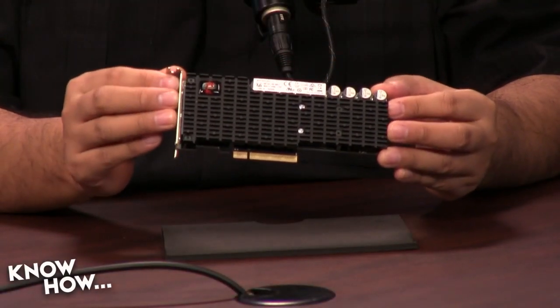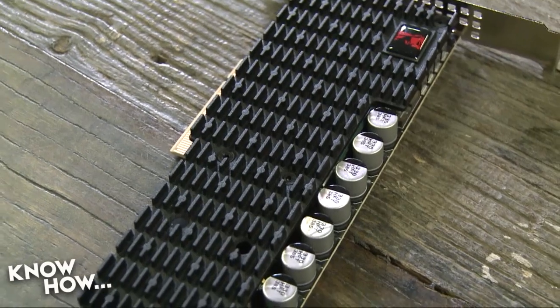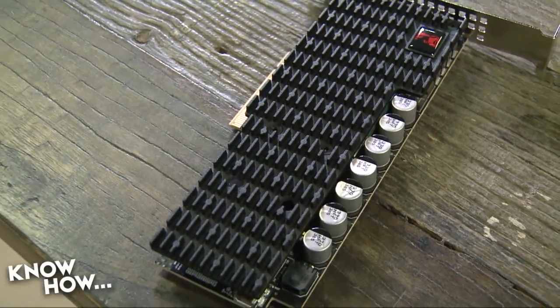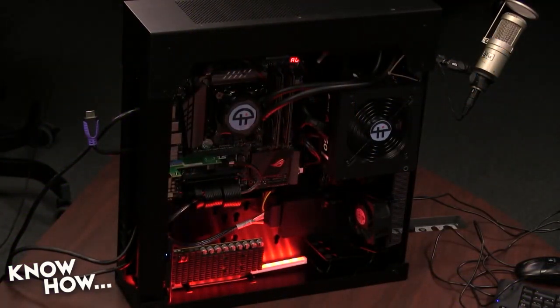What am I holding? So you are holding our new DCP-1000 NVMe high-performance server-class SSD. NVMe is really what's enabling the next jump in performance for solid-state drives. NVMe brings standardization to how we attach SSDs to the PCI Express bus, which brings the cost down. And we've got a few different form factors, half-height, half-length cards, like you've got there, as well as 2.5-inch.